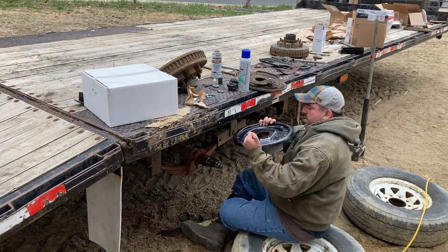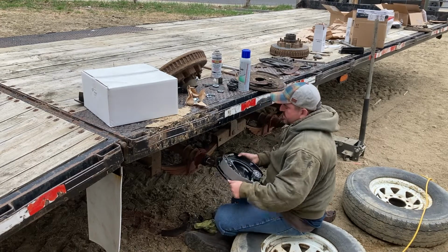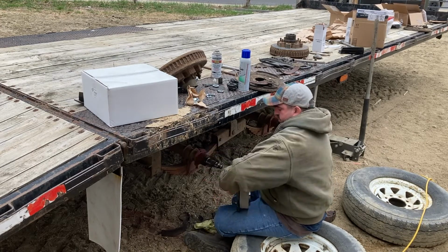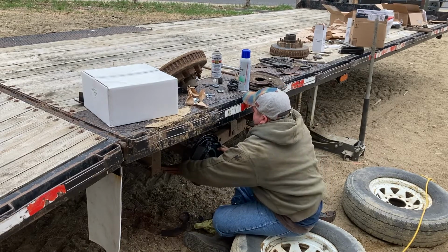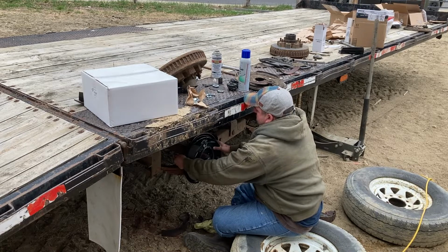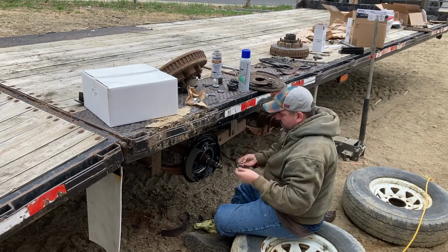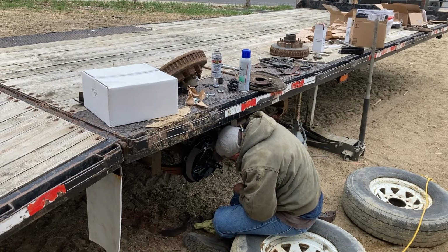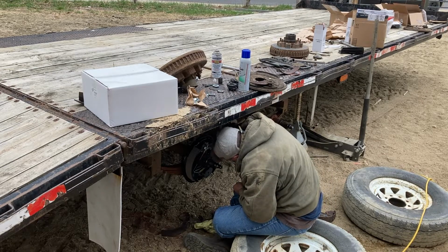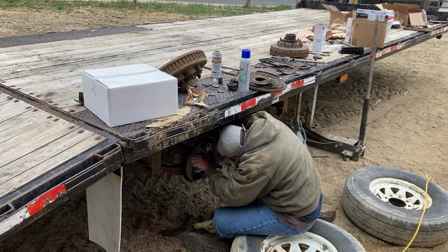So, these self-adjusting brake shoes are listed per side. This is a right-hand one, so that's pretty easy to know that this goes on this side. The wire's out of the way. There are 3/8 fine thread bolts. I had to go to the hardware store and pick them up since my kit did not have the bolts in it, just had the nuts, which is useless.